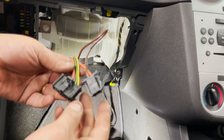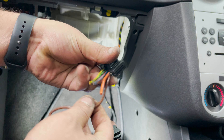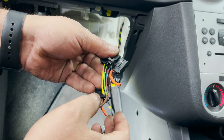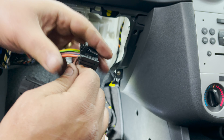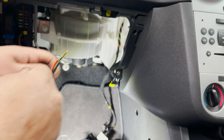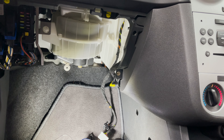I'm going to replace that and then show you the old plug. Right guys, the wiring loom is fixed. That is the old wiring loom that was in the car. Like I told you, the brown ground wire to the motor basically goes through the resistor. Instead of going through the resistor now, it's joined with the orange, so that's why I have four wires now - the brown wire is eliminated. You can see this wire is all burnt there.